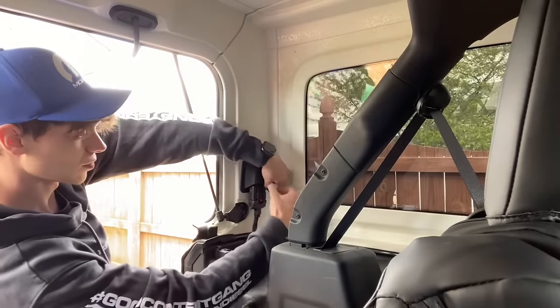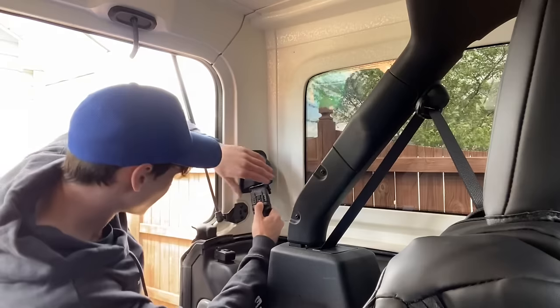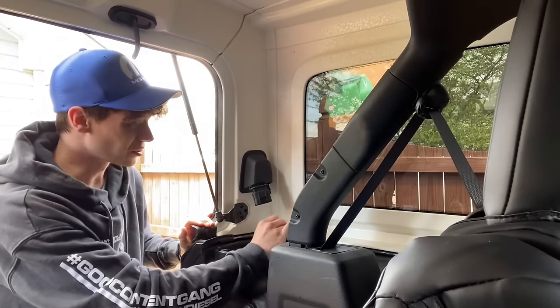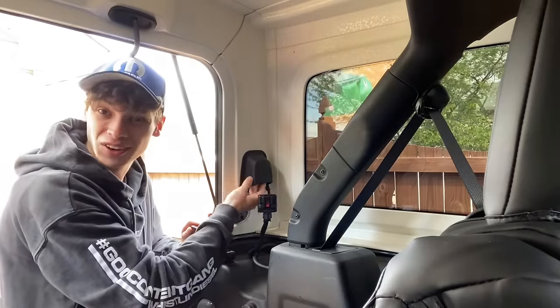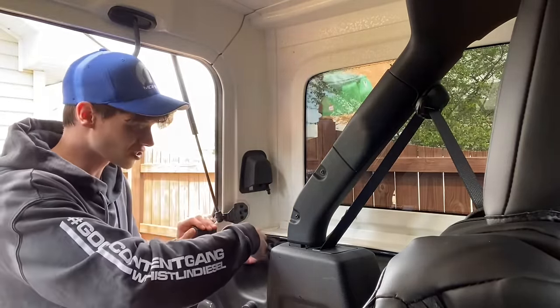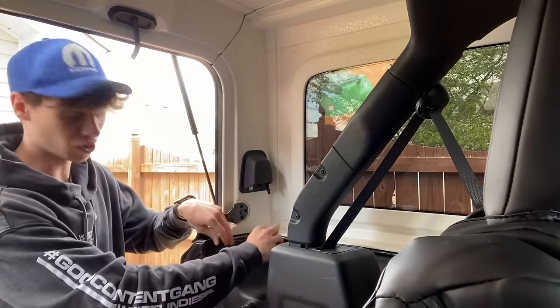For the JLs and JKs, you've got a nozzle back here that goes to your washer fluid. You've also got everything controlling your defog as well as your actual wiper motor itself. So we'll disconnect those real quick — you just basically push them down and pull it apart. And for this one right here, you just pull down the red tab. Once you pull it out, you should be good to go. I usually pull a little too hard at first and this piece comes down, but it's no big deal — it literally comes out and I just push it right back up. Jeep actually gives you some built-in plugins back here so you can plug them in to hold them down. It makes it really easy.